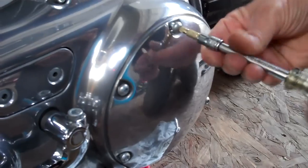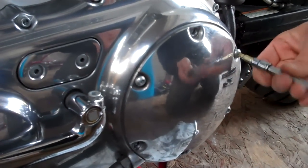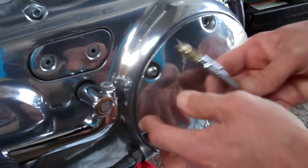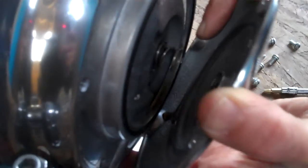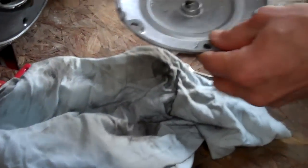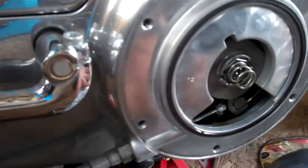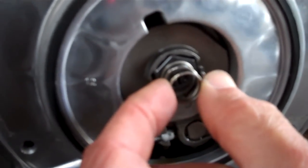The cable itself will have lots of slack. There's a little spring in there that pushes the cover off. Take all the bolts out and be careful removing the cover because down inside there's a spring we don't want to fall off. There's not much leakage — that's nice and clean. Set the cover on its face so you don't scratch the casing. The rubber seal around the edge — the book says to replace it, but if it's not leaking there's no need.